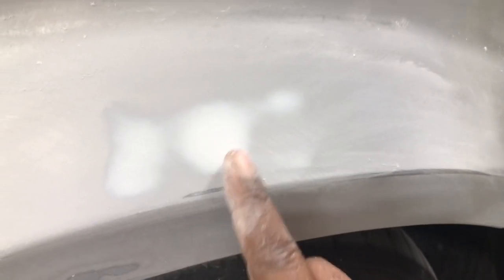Now, when going in that X pattern, you will see that either your filler or your glazing putty will break down evenly and fill in that area. And that's what it should start looking like when you go in that X pattern. It will break it down, fill in the area, and it'll be even. We had a nice good ding here, if you remember from the last video, and you can see that the glazing putty is filling it in. I went in an X pattern in both directions, doing my cross, and it filled in both sides completely and evenly, so I don't have to worry about it looking wavy